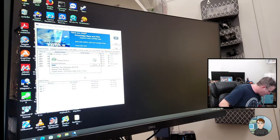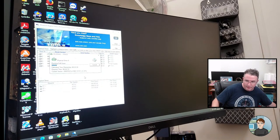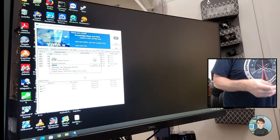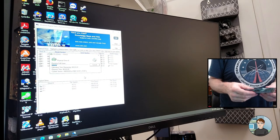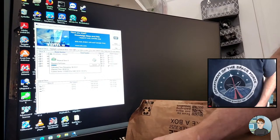And what's the odds that the original RAM plus the two new sticks are all bad. What's your thinking there, Chris? That's a tough one. I don't have another M.2, and I don't want to go erasing, formatting the guy's drive, the kid's drive, just on the off chance it might fix it. Let's see, do I have any NVMEs that I'm just not thinking of is the next question. Maybe I do, and I'm just not remembering.